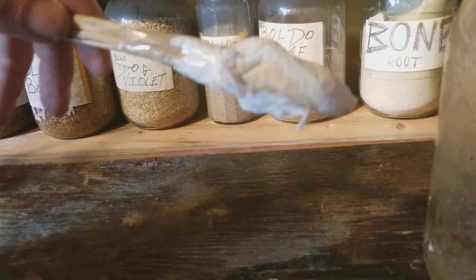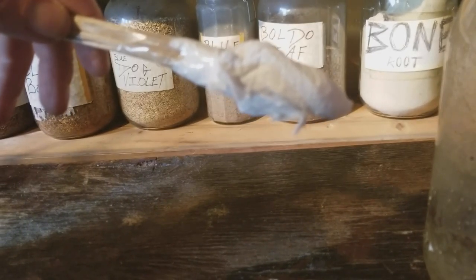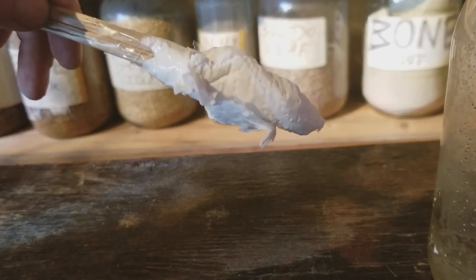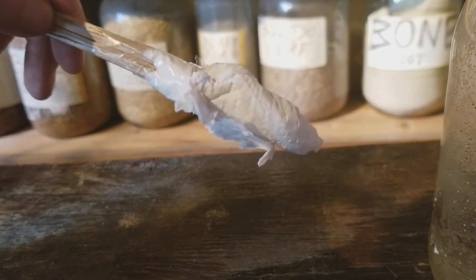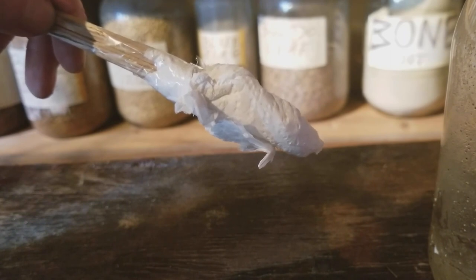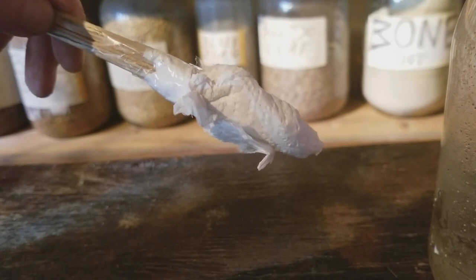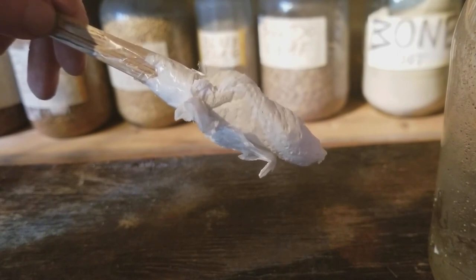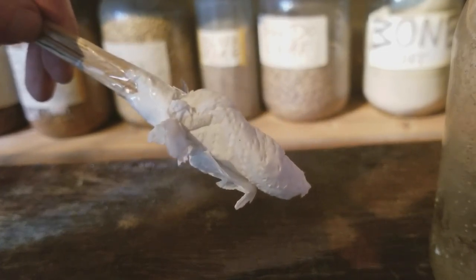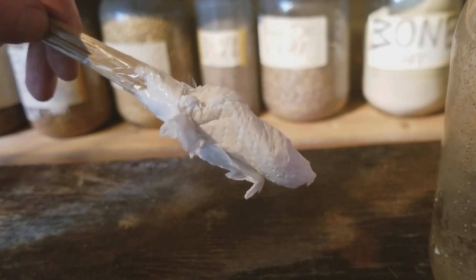And so, like I said, what I did is I used apple cider vinegar with Simple Green, a little bit of OxyClean, and some isopropyl alcohol. I don't even know what proportions I used of what, but mostly cider vinegar. And this is like $2.50 a bottle, you know, an X amount of sprays of Simple Green, couple of little bits of OxyClean. And so let it sit, swish it around a couple times a day, and then just shine a flashlight in that tank, and you'll see where I get the corrosion and clean it out more.